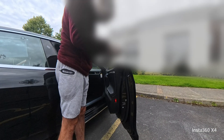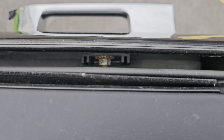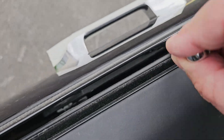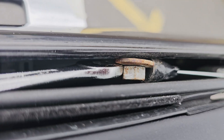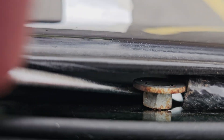Window down, trim off. Following some other video's advice, unscrew the top nut holding the handle — there she is, hiding in a weird place. Also following the advice, tape over the handle with masking tape. Keep it snug, as sticking out pieces might be catching. A flat 10mm will do the job. Keep the magnet close — you don't want the nut to fall and get the window cracked or scratched, or go fishing for it for an hour later.